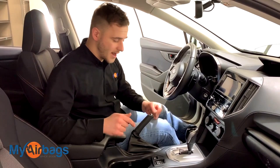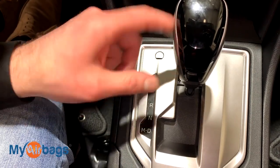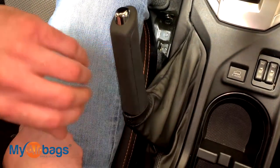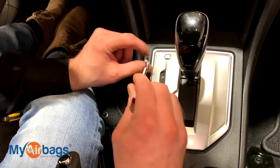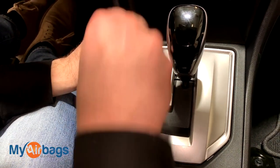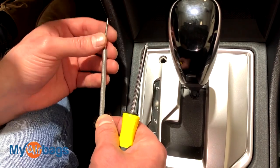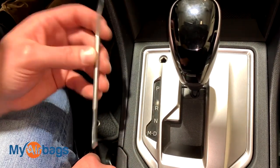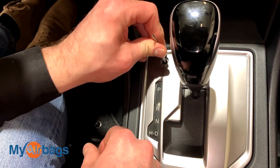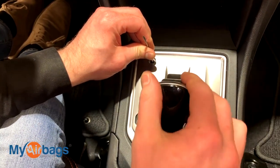The first thing we want to do when we get inside the car is start working on the center console. First, we're going to work on the knob and the shift. We want to get the shift into neutral, and I have my e-brake on already. Use a little pry tool — a flathead will work — and lift up this little plastic cover piece right here. Then grab your Phillips or anything pointy, even a pen or pencil. Press right into there; you'll feel it depress a little. When you feel that, grab the handle and pull down to put it into neutral.